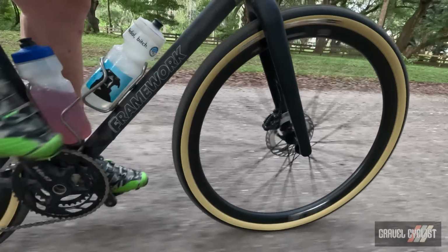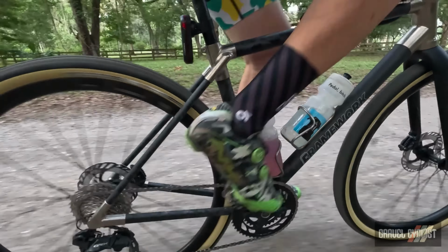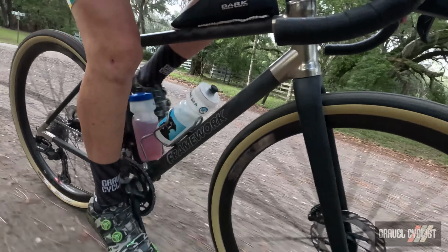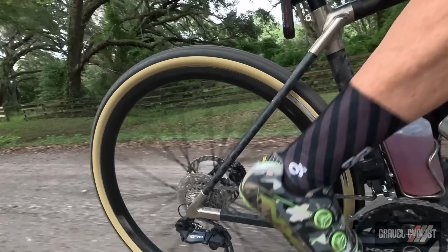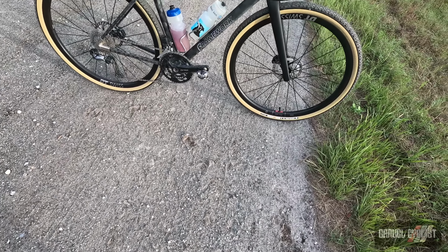I haven't racked up pro volume riding on them, but following at least 2 months of solid use, tread patterns are looking good with plenty of rubber remaining. I experienced no bottoming out or burping at these low pressures, but these tyres are sensitive to pressure, so tinker to find out what is ideal for you. I guarantee you it'll be worth it for the comfort and feeling of speed.